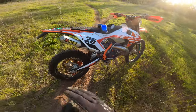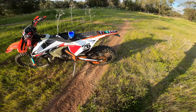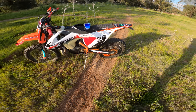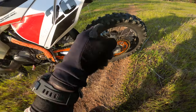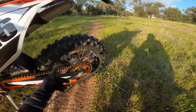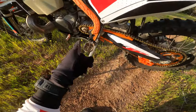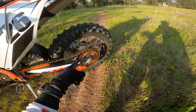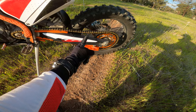I really like the way the bike looks right now. I didn't wash it for one year so it's really nice to see it fresh and clean. I also put a new chain - this is the 520 chain I got from 24MX, the X-ring version - and the sprockets: 13 on the front and 50 on the rear. I also got a new chain slide and chain guide from Acerbis.